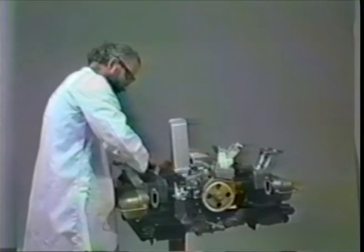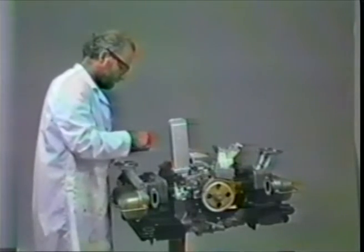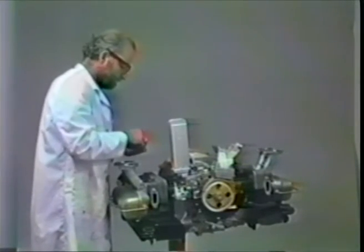with the small outside diameter washer over the studs, and then a flat washer and spring washer for the long bolt. Screw the long bolt in a way to get it started. Put on a couple of nuts using 13mm across the flat nuts here. The long bolt, this one for the manifolds, should be a 14mm across the flat. For 356s, 912s use a 13mm across the flat bolt. So you can usually reach the other side, just get them on loosely. And we'll go back and get our wrench out. 13 and 14mm socket in this particular case.